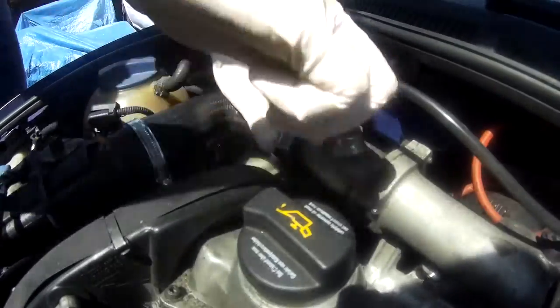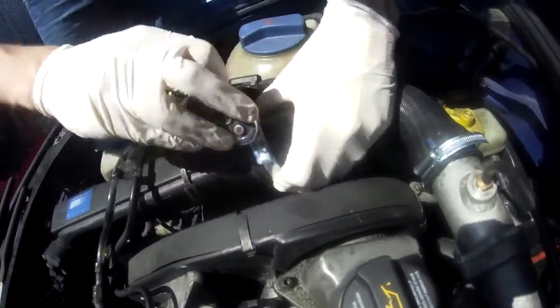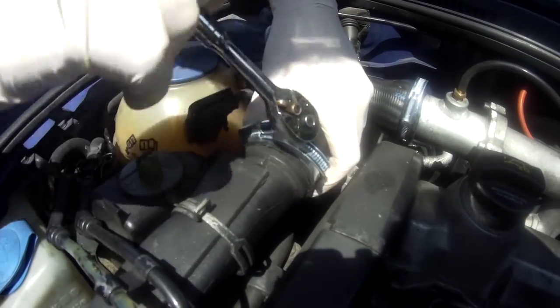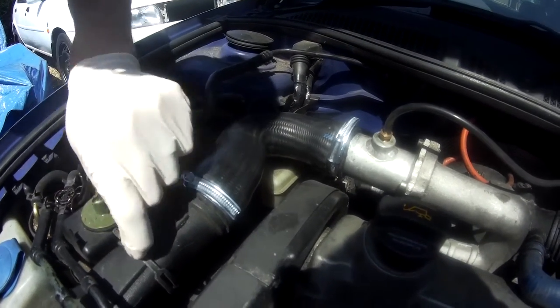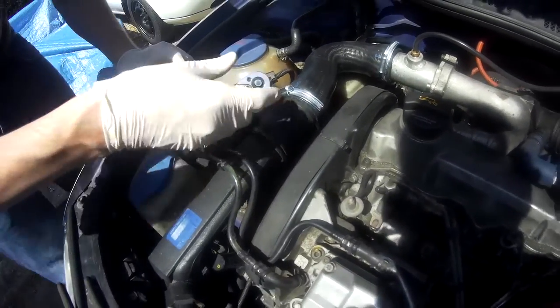So you can just see me tightening up here, and the nice thing compared to the spring clip is you can very slowly get them into the right position as you tighten everything up, and you can adjust it if you need to. This becomes really beneficial in tight to reach places — around my intercooler and around the turbo underneath the car, everything's really tight to get wrenches or pliers into, but I can easily get a socket or a spanner down there to tighten things up.